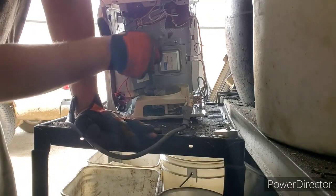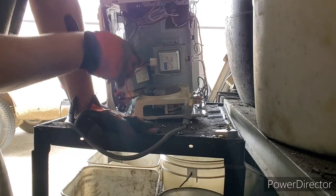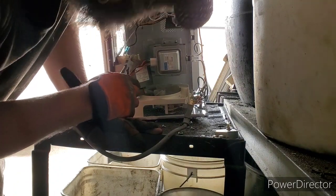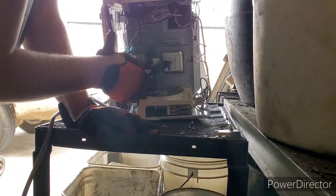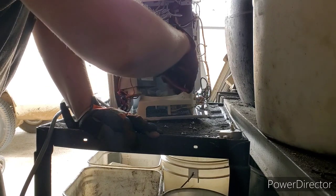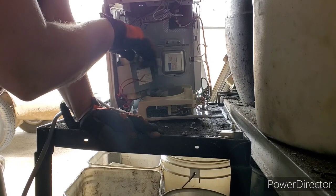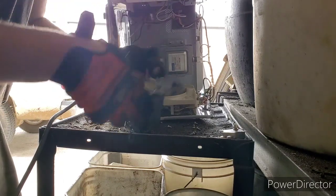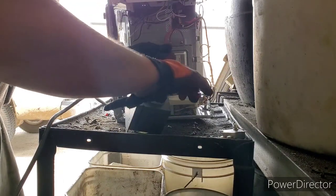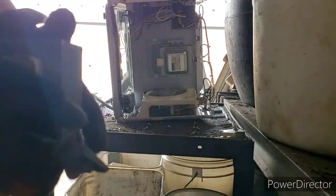Now to the interesting side right here. As you guys can see, we've got a transformer, a magnetron, and another copper motor down here — all this stuff. To do this, you want to get rid of where the capacitor is first and the magnetron, that way you guys don't get shocked. I've never personally been shocked by one, but I hear some people have.